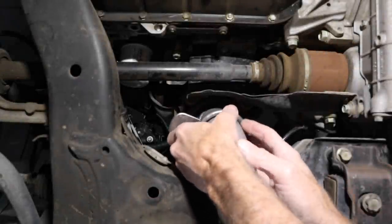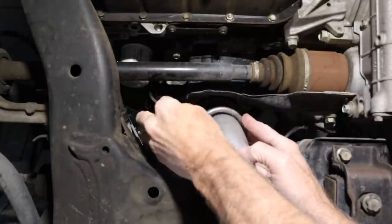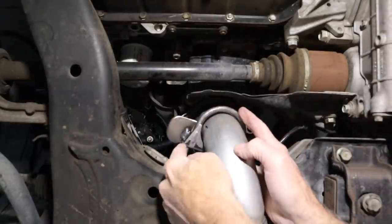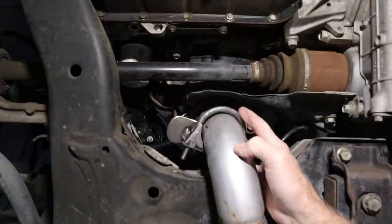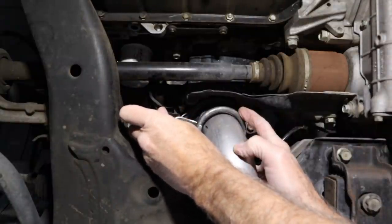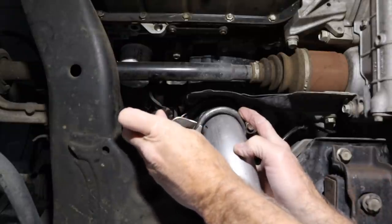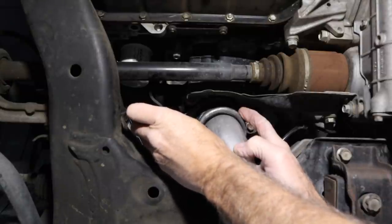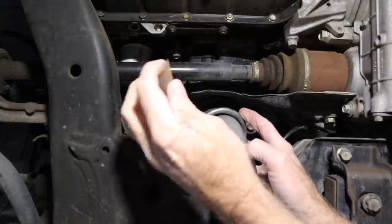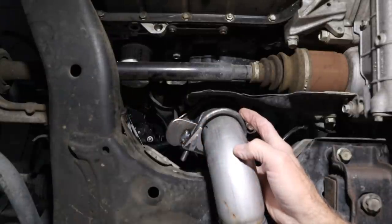All right, so you can see the bolts right back there. This fits right on there just like that. Now this plate's gonna be at a bit of an angle, but I'll cut the tubing at that angle and then figure the length. So I'm gonna mock this up, measure the distance up around that bolt, and figure out the length for this tube. I'm gonna get it right up to it, not touching, so they can jiggle and not bang or click or be irritating. That's the next step, and it's looking pretty good. I'll probably throw a nut on here, a nut on the other side, get this figured out, cut, and tack it on there, and then hopefully we'll be able to weld it up, and that'll be it.